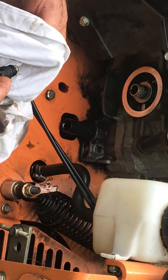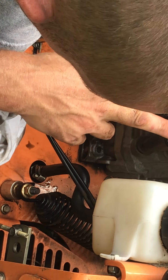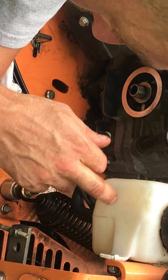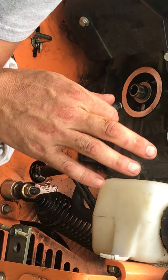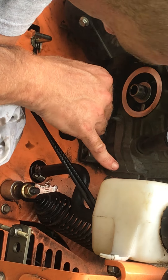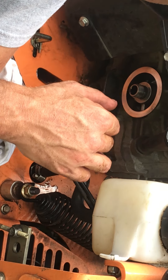We're in a recession right now, so saving a little money helps. And it's good to learn how your engine works. Right here is your dipstick, here is your oil filter, and that's your drain plug. This little white tank right here — don't ever worry about this, it's your safety net. If your mower gets too hot you'll see this thing fill up. When it's cold there's a line here marked 'Hydro Gear' and 'Full Cold' — when the engine is cold and not running, your oil level should be right at that line.